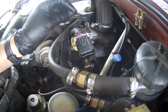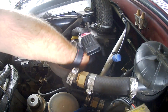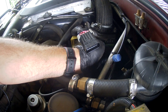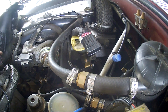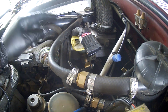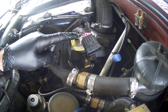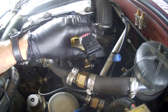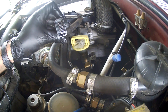The plugs have got seals on them, but the seals are not what we would call brilliant. If we look at the other end of this, you'll see it has a green seal on it — a similar seal sits on the small plugs on top of the injectors. But oil can get in there, and oil does get in there. Because these are stranded copper wires, you get capillary action coming down those wires, and there's nothing to stop it extruding into that plug right there.